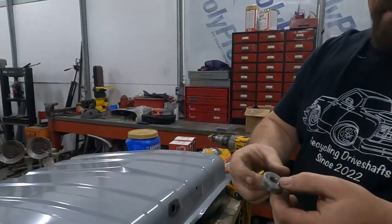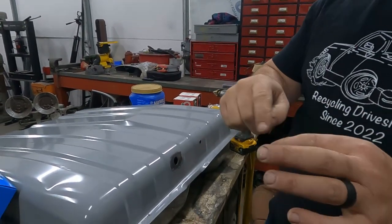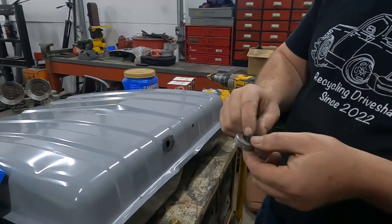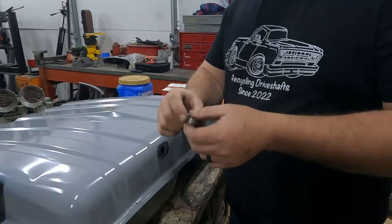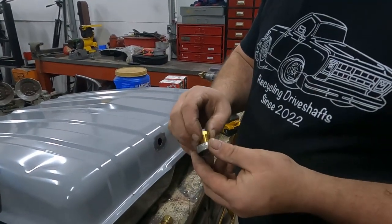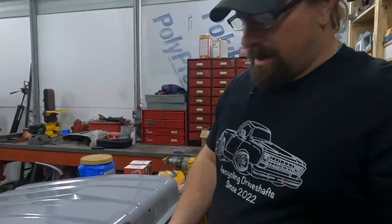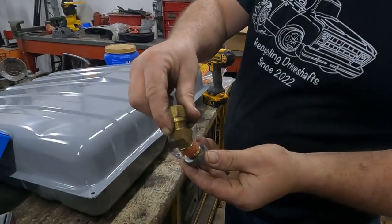So all I did is I cut a piece of 3/8 plate out on the drill press with a hole saw that gave me a bung. And then I drilled it and tapped it for quarter inch in the middle. And I made these a little bigger than I needed to for quarter inch, because I'm not 100% sure quarter inch is going to be big enough when we get ready to. I think it will be, but just in case it's not, I made these big enough so that if I have enough meat, I can go all the way out to half inch.